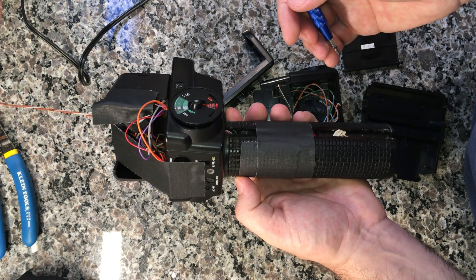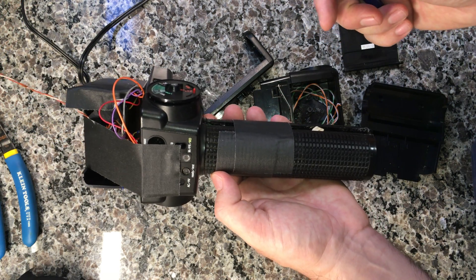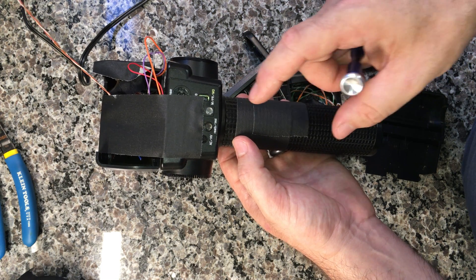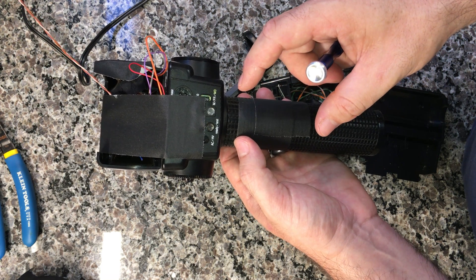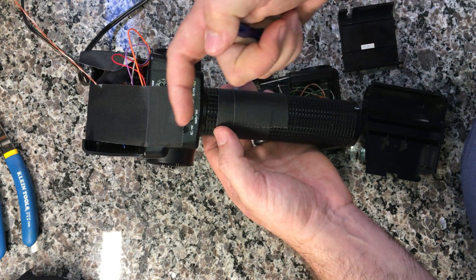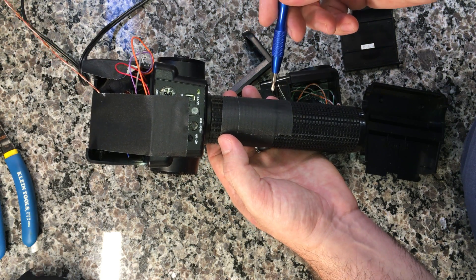But the array of wires is just ludicrous. You've got to really watch where all these things are routed because there's almost no rhyme or reason to the way the wire routing goes. So you've got to be careful as you open it up, watching which way something passes — if it goes around a board, behind a support, etc., make a note of that as you're opening it up.